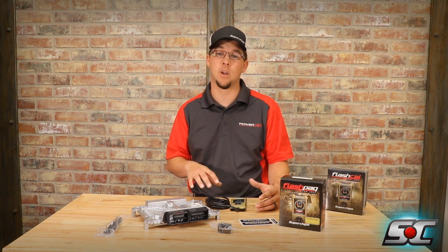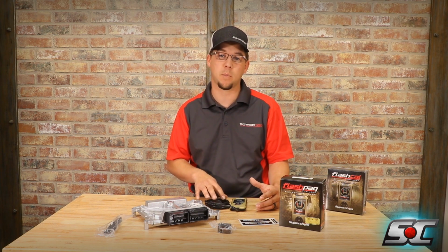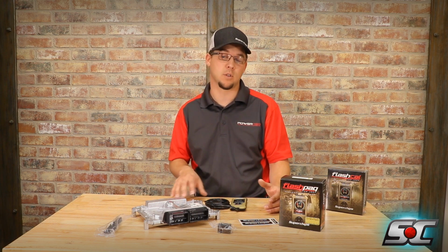The Flashpaq is going to be offered with an 87 octane tune for you guys that are just looking for your peak horsepower and peak fuel mileage. That's a nice daily driver tune that should net some good improvements in both drivability and fuel mileage. Obviously, we've got a 91 octane tune and then our high performance 93 octane tune. All of those will be user selectable.